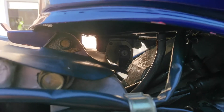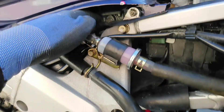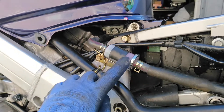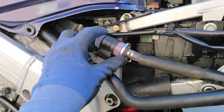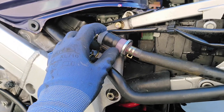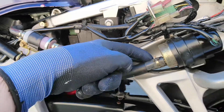Flick it like that and it's back on. From the fuel tap it leads out on the other side via some rubber fuel line into an inline fuel filter. The inline fuel filter is directional, so you have to make sure that it's put on properly. Its role is just to filter the fuel — inside it has a paper mesh to filter the fuel.